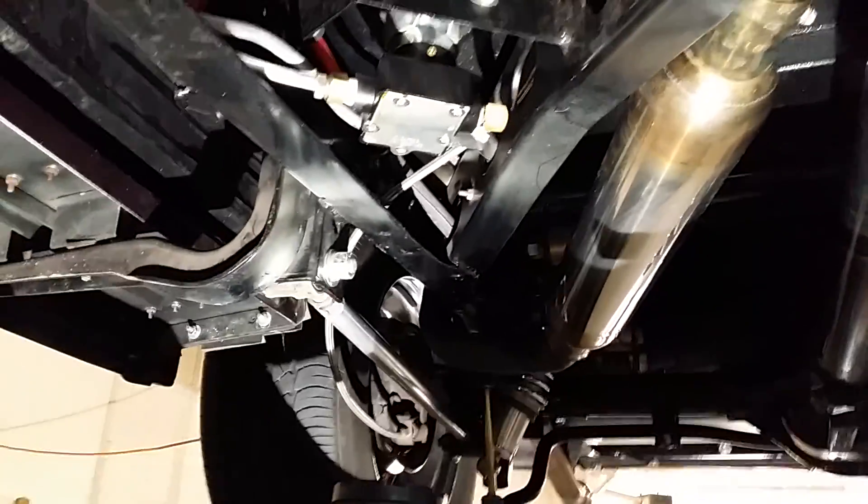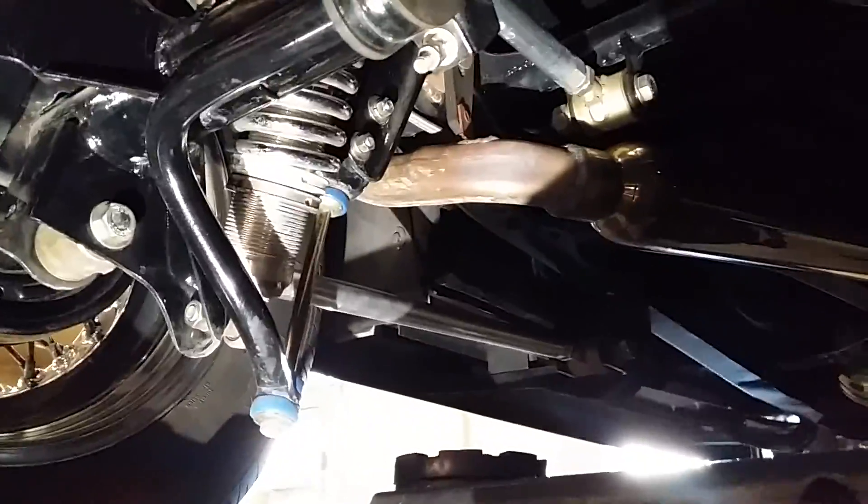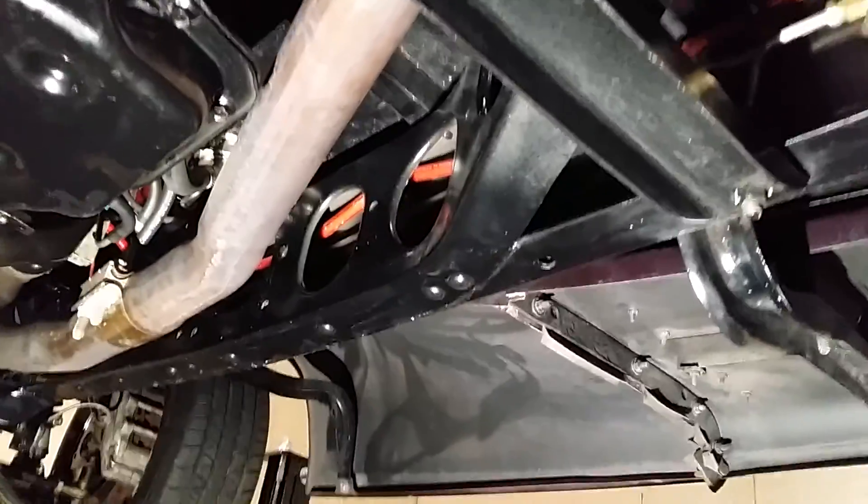There's a rear-mount battery with a cable running to the back compartment under the seat. Billet coil overs in the rear with the same four-link adjustable setup. There's a little 10-bolt setup with a sway bar and four-wheel disc brake components. The rear end is reported serviced and gone through — I don't see any active leaks or anything abnormal. Backing plates are done up nice with plenty of adjustment to make the car go straight with the four-link setup. Polished fuel tank, electronic fuel pump, brake lines and fuel lines all look to be in good serviceable condition.